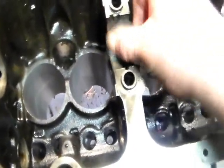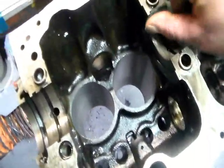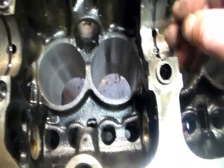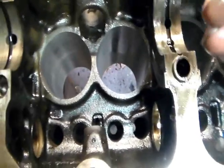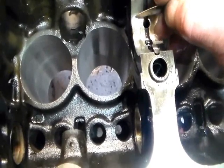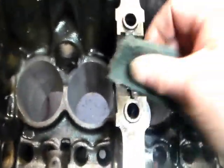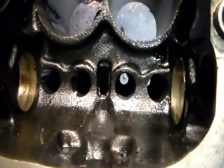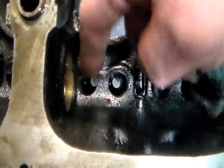There's no point putting stuff like this together with paint and crap - you've already seen this morning that we're talking thousandths of an inch here. You can't leave paint in there. There's no point having things measured accurately and then just chucking it together with a big handful of sand at the end of the day. And some of that paint - see, it's just about ready to fall into the sump.